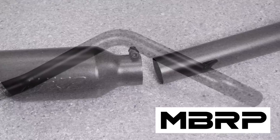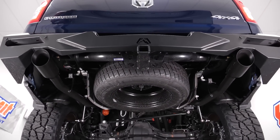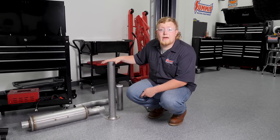Both these are fairly simple bolt-ons and they can be done in stages for more modification later on. We went with the MBRP Black Series cat-back exhaust to maximize flow and match the rest of our Black Scout parts on the truck. We're ready to start our exhaust install, beginning with our front tubing, which we went ahead and shortened for our quad cab truck.